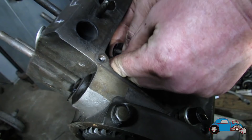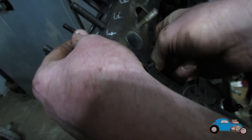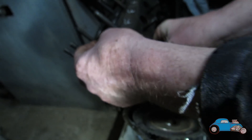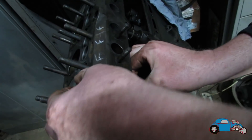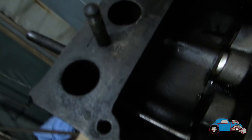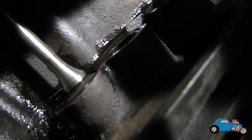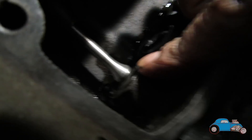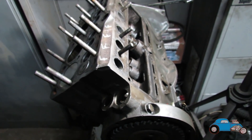Put the valve guides in — they're two-piece valve guides in these. Push it up into the recess. It's a bit awkward in the corners because you haven't got enough finger room like you have with the rest of it. That's probably alright if you had little hands — probably a bit easier. I get my shovel hands off my dad. We've got to push that down on the seat and then get the gap right. We've got to check the gaps here between the valve and the lifter. If the gap is too closed, it doesn't allow the valve to come down onto a seat, so that won't create a seal, the engine won't have compression and won't run.